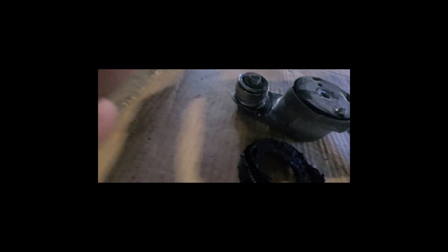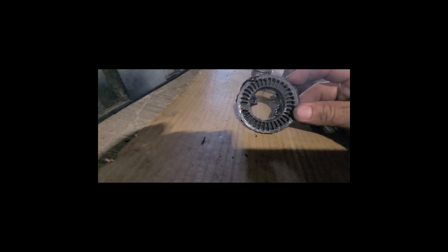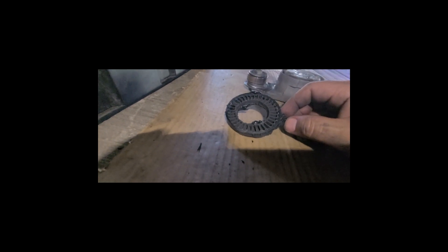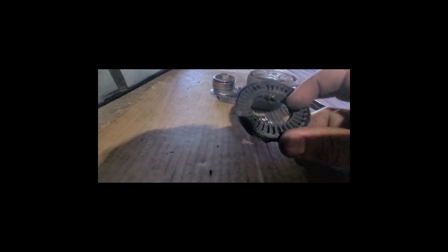Now what I found out on this tensioner — you can look at the pulley. Here's the tensioner and this is the pulley. Sometimes I hear like a squeaky noise from the serpentine belt, or when you were turning the wheel you can hear like a really hard cracking noise. So yeah, I found out that this was the problem.